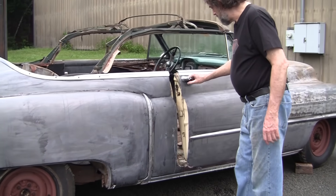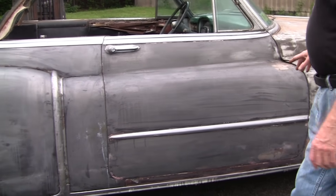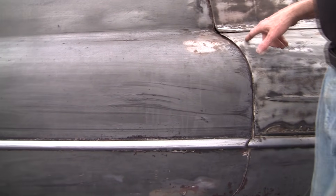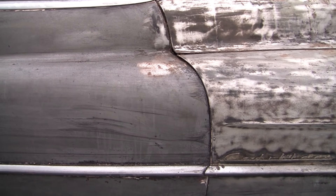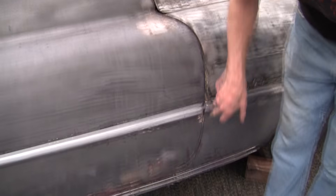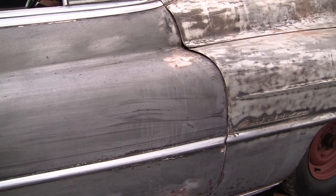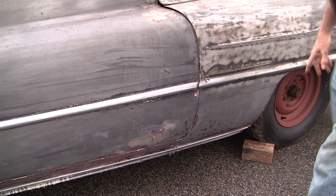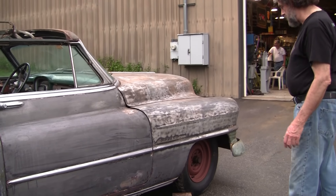This door works pretty good. I think the gaps from the beginning weren't the greatest on these. The real oddity of these early '50s Cadillacs is the door actually opens and goes underneath the front fender — you can see how that goes underneath right there. So from the factory this was misaligned; the gap is not too bad, but this surface is not equal here. That's just the way they were made. And I think we've got a crease dent here. We found a little bit of bondo lower — they were hitting some kind of stone wall or something making a tight corner.